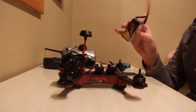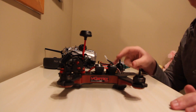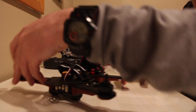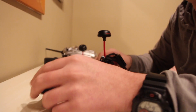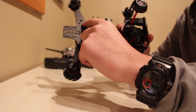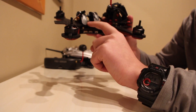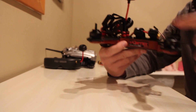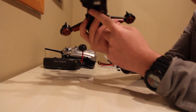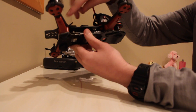The last thing you're going to need is a battery to turn it on. So the first thing you got to do: props off. Second, you're going to start taking out some screws. You're going to need to remove three here, three here, and there are four on each side on the side panels — two on the top, two on the bottom on each side — so that way you can lift the panel up and have a view on one side.